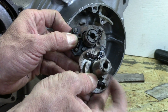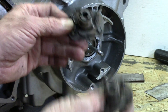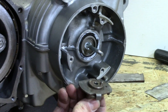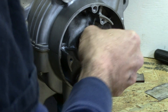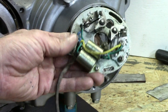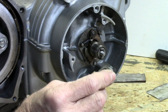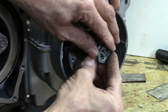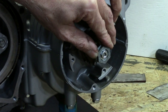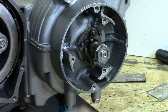There are some things you can do where you can take this cam off and put it on an earlier one or vice versa and get some different timing curves. We may play with that later, but for now we're just going to stick with the stock one. Make sure that the dowel pin lines up in the hole on the crankshaft. We're going to put that on there — and there it is, it's lined up. We're putting on this special nut and washer and then the 6mm nut, only temporarily to hold the advance unit in place so we can set the cam timing.